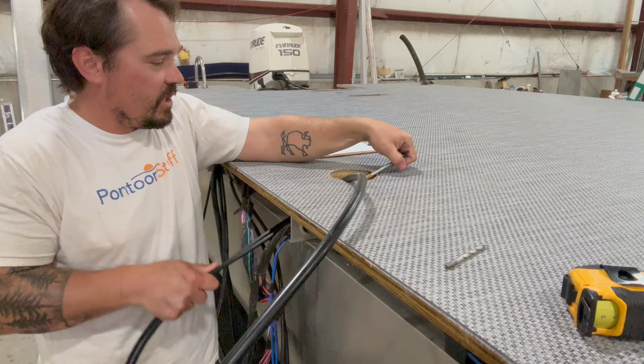So something hugely important to make note of when you're doing a boat like this with U-shaped pontoons. Those cutouts there are for electrical and for fuel system access. I like to start with my steering cable because that's the hardest one to manipulate and get through. It's just not as flexible. It's a 1/2 inch, there's steel in there, hard plastic. So we're gonna run that up.